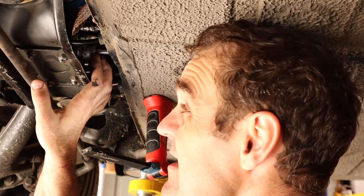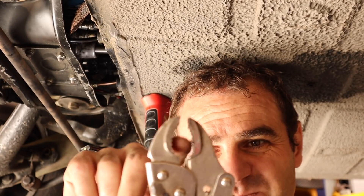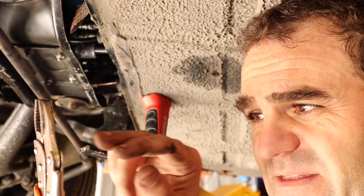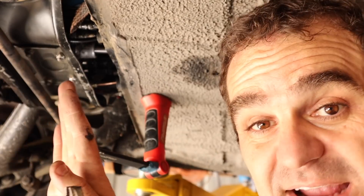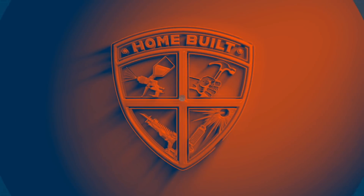The seal is now in. I cut a short piece of aluminium tube, which is nice and square on the end, slid that over the top of the shaft, then used vice grips clamped loosely over the shaft — not grabbing the shaft, just sitting on the end of the aluminium tube — so I could hammer lightly onto the vice grips to get a nice square press into the end of the gearbox. It wasn't overly difficult. Making that hook tool with the screwdriver really helped getting the old one out.